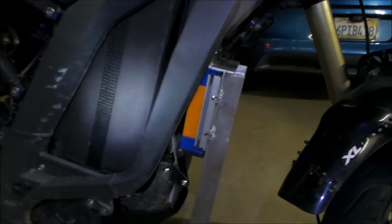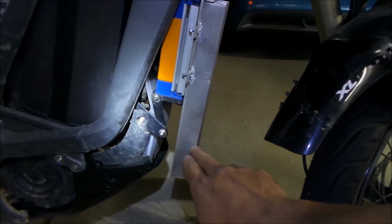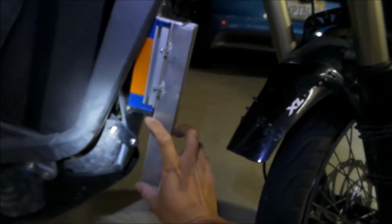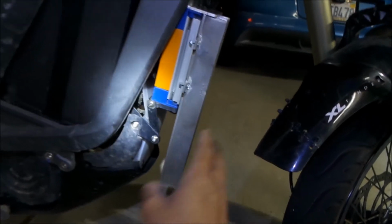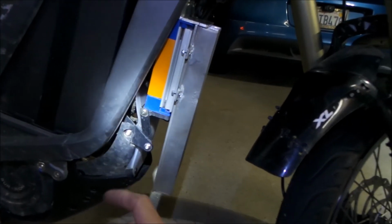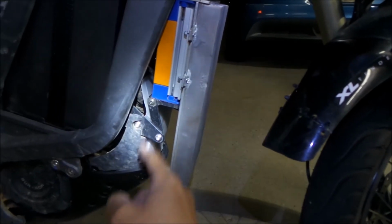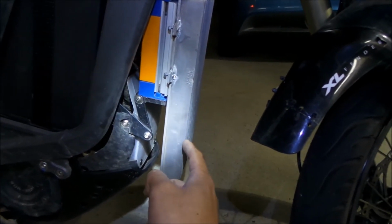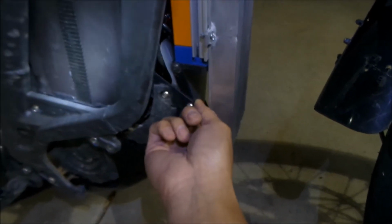It's not supposed to go straight down like this one. So I think what we're gonna do is chop this heatsink in half from here. I'll measure from here to here. We'll chop it in half, then flip it around and bolt it onto itself. And I think we're going to have to cut off one of the end fins on the one that we flip around so it doesn't come into contact with the bolt here or the nut.